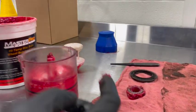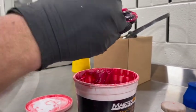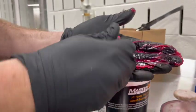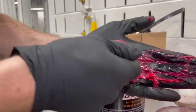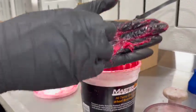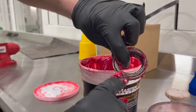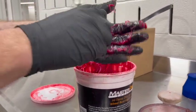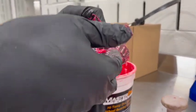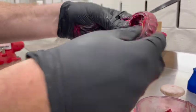Old-fashioned method: take a dry bearing and get a little bit of grease in your hand. Work the bearing in a motion wiping it across the palm of your hand — you can see it starting to pack that grease in. It's a good idea to wear a glove if you don't want to get your hand nasty. Work that grease in, wipe off the extra, turn the bearing a little bit, and work more grease in. By the end you want to see grease squeezed all throughout the cage area, all the way around. It's a pretty messy job, but it's not hard at all. Once packed all the way around, put a light coat around the outside.